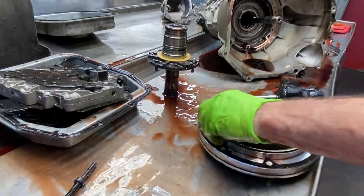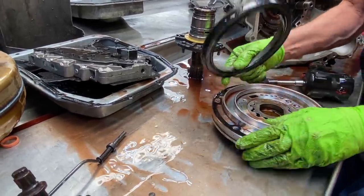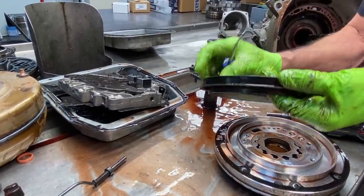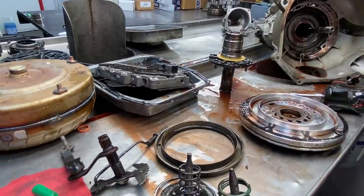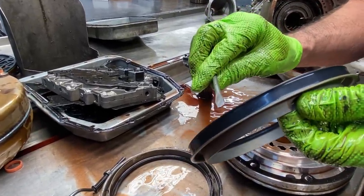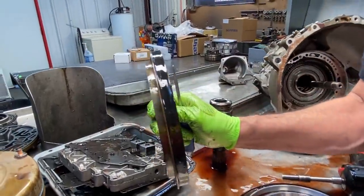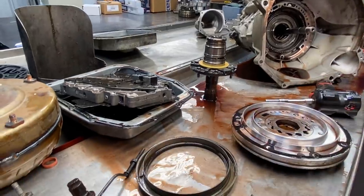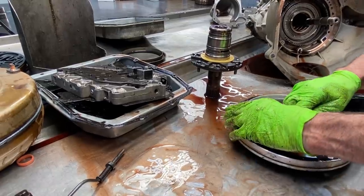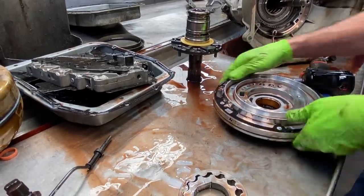Clutches have to be cooled — they have to have some type of oil flowing along. This old seal feels really hard all the way around. You can see the new bonded piston — how the seals stick out really far and are going to fit really tight, compared to the old one that's laid over. That's why you want to replace all your seals and bonded pistons. If you can get an overhaul kit with bonded pistons, get them all — put them in there, all your servos and stuff too.